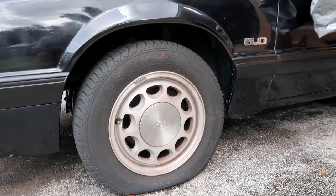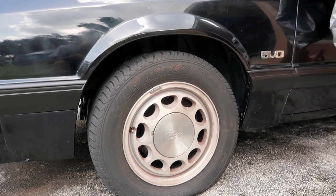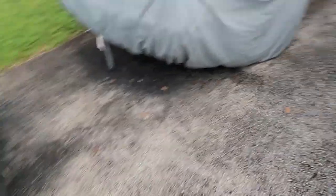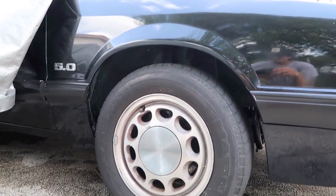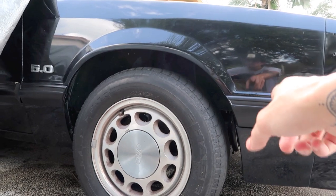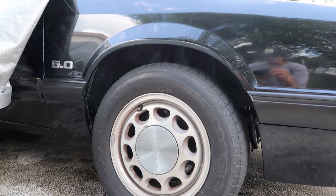It's an old mustang and I don't really think it's going to ride much different. It's going to be a race car, so obviously eventually I do plan on putting full suspension in the car, but for now we're just going to send it and get it done. Before we jack up the car, I want to go ahead and take some measurements so I'll give you guys a better idea of exactly how much lower the car gets by cutting one coil off the springs. Hopefully this will make it a little bit easier for you guys to decide whether this is what you want to do to your fox body or not.